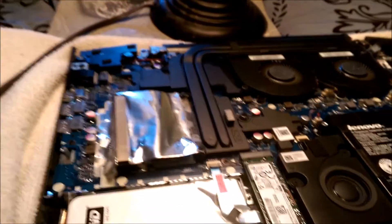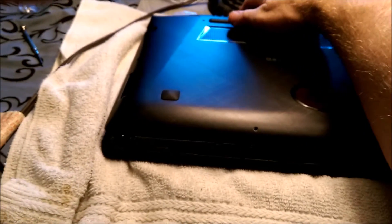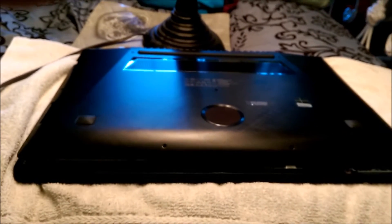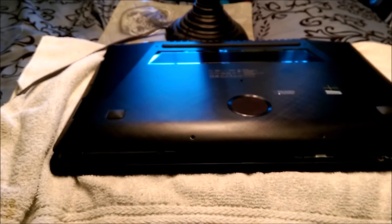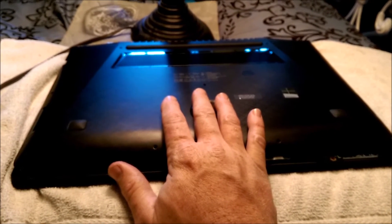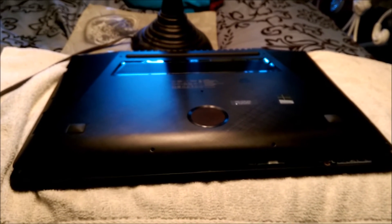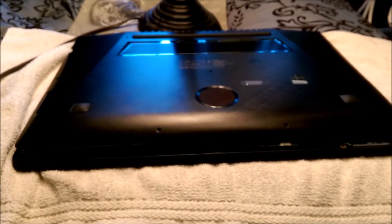That's basically how you install your SSD. When you're ready to put it back together you reverse the steps — take your back cover, put it a little bit past, then pull forward, push it down along the edges and replace all your screws and you're ready to go. I hope you enjoyed this, sorry for the production quality. Maybe I'll show you the next step in another video — the whole booting into Windows and getting your drive ready as a bootable drive. Thanks for watching.